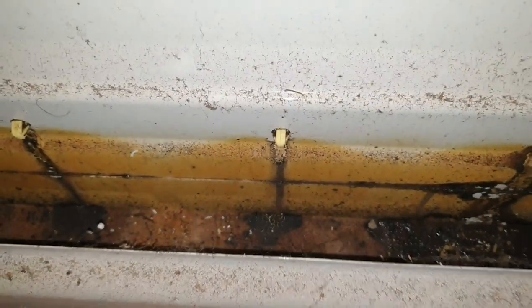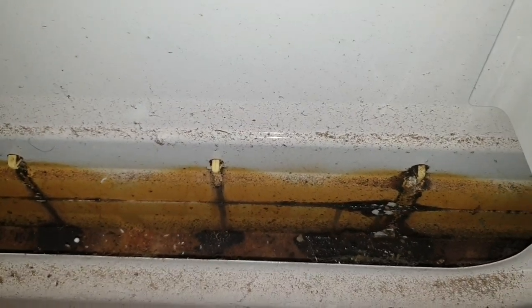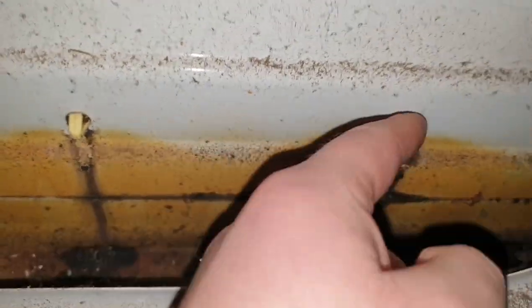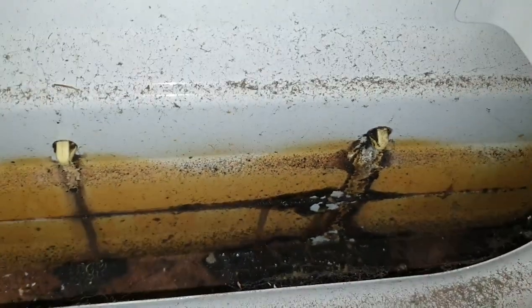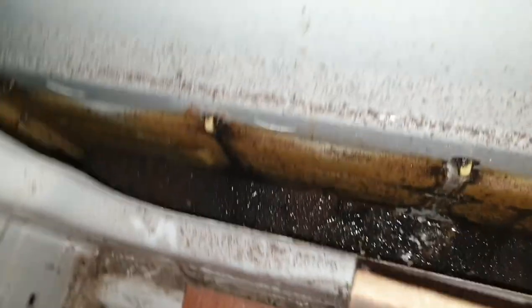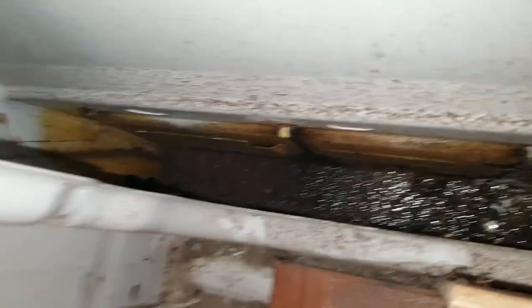It's wet down there, and that runs down to the end and fills up in the sill. So first thing tomorrow will be to get under the van, unblock the drain holes in the sills, see how much water comes out, and waterproof every single clip — anything, even a bit of mastic. You can see why they rust so quick. If no one knew about that and you just left it, you'd be driving around for years with litres of water in your sills, rotting from the inside out.